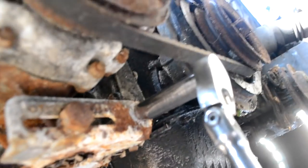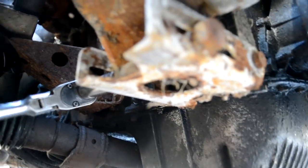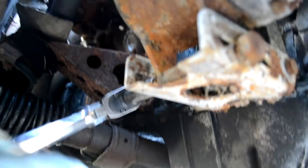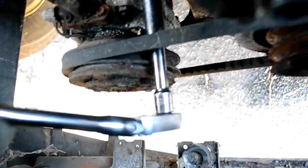Now for the air conditioning bracket — it's a little simpler than the power steering. There are 13mm nuts that hold it on, and these are pretty tight, so it doesn't hurt to spray it down with penetrant oil. You don't really need to take them out all the way; you just need to loosen them enough so that you can move the compressor around. There are a couple that tend to hide in some places. Don't crank that toothed nut if it's too tight, because you will just strip the teeth out and then there's no way of tensioning the belt when you're all done.